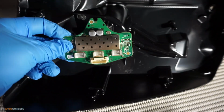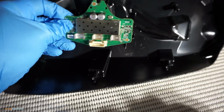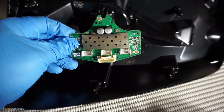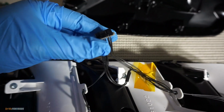Once you take apart this assembly, you basically unplug this plug carefully, and you find this controller sitting in the back of this board. So what you have to do here, just unscrew everything you see. There's 3 screws here holding this board, and same as 2015 and 17 model, this outermost board stays as it is. Replace these 2 with the provided EPM board, and replace this harness with the provided harness in the box.